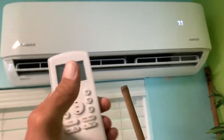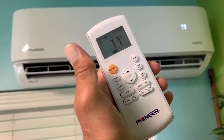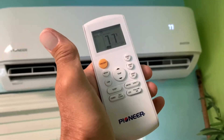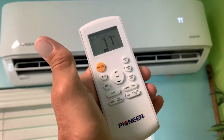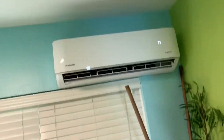All I had to do was change the batteries. If this thing stops working but you still see the numbers in the display, it doesn't mean it's broken — you may have just enough power to light the LED but not enough to connect the remote to the unit itself. So change the batteries first; don't call the air conditioning guy and spend $200.